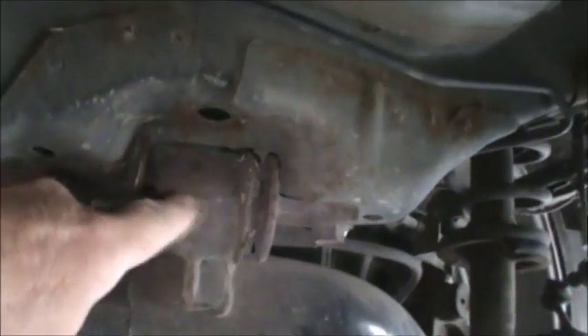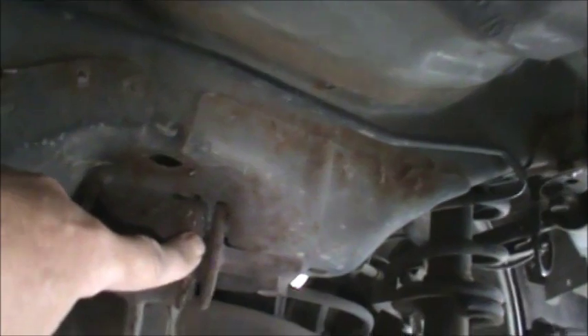The car is very much rust-free — we have a little surface rust starting right here, but we have absolutely no rot. So we'll just wire brush this down here a little bit by hand, and I'll be painting the underneath with a little rattle can Rust-Oleum flat black — that's what I use on all my cars underneath. It's just a rust preventative more than anything else. We'll replace all rear suspension bushings and replaceable stuff — we'll replace it all.